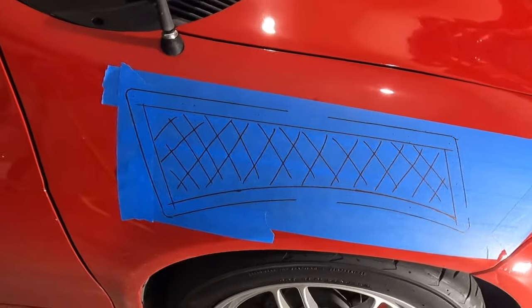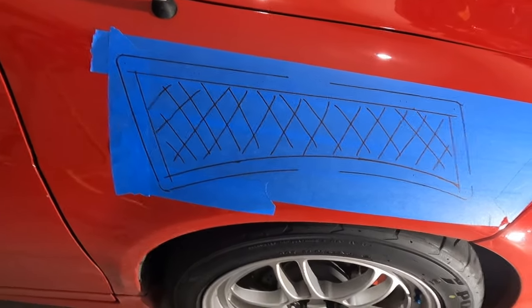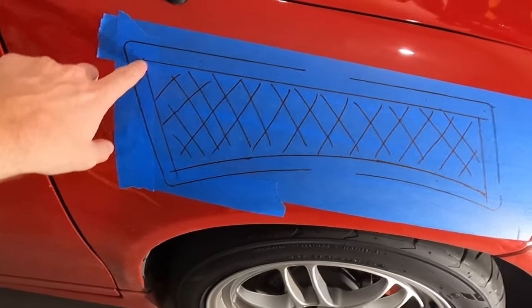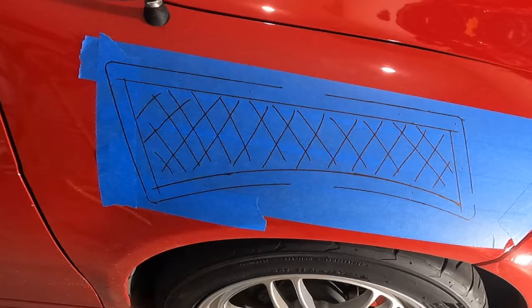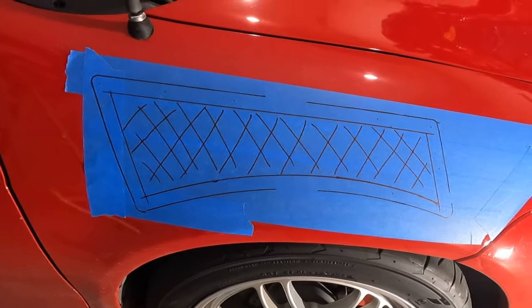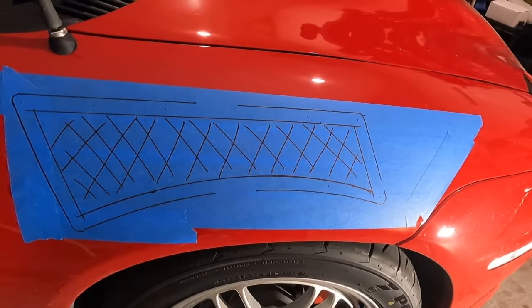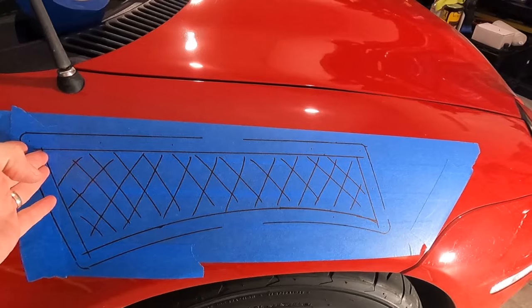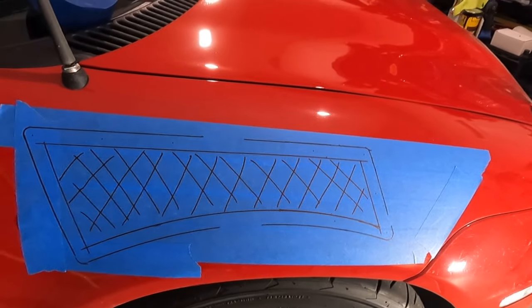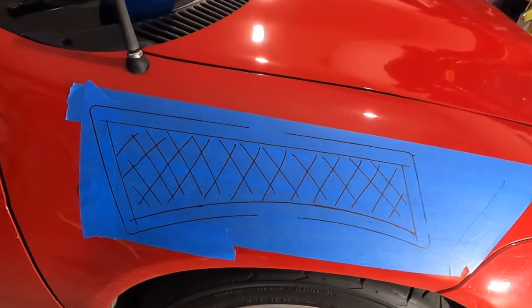See where we got the cut. I am on a little bit of the conservative side on this black line, so if I cut directly on the black line that I have marked, I'll probably have to grind a hair away with the flap disc, which again I'm not super concerned with, but we'll see. I'm going to cut on the outboard side of it, so I hopefully don't have to do that, just to save myself a little bit of work. But next step now is to cut.